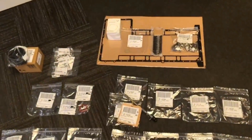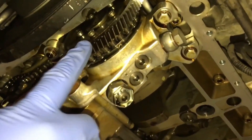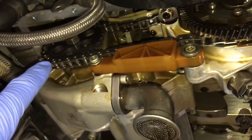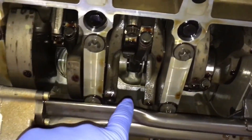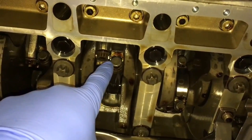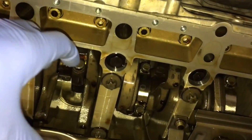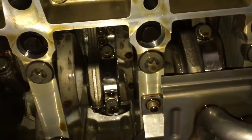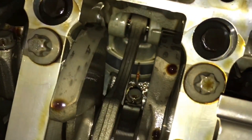The subframe is now off and we've also got the sump off, with the engine supported on our special tools, and we get the first look inside the bottom of the engine. This is the vanos high pressure pump directly driven by a gear wheel straight off the front of the crankshaft gear wheel, and then it's chain driven across to the main engine oil pump. These are the two pipes - a pickup pipe and a return pipe. Looking up into the engine block you can see the pistons in the distance, the connecting rods here, and these are the con rod bolts. The bearings wrap around where they're actually sat in the con rod and con rod cap, designed to sit around the crankshaft journal and float on a film of oil. This is a nice view of the con rod just here, looking up to see the piston.